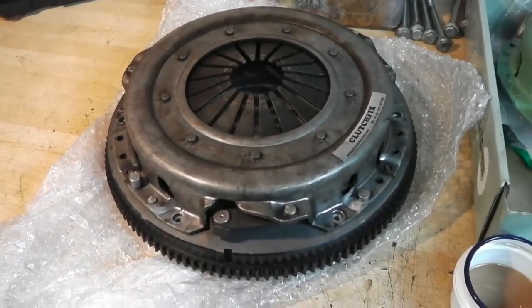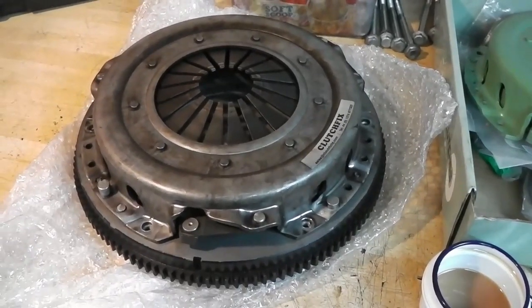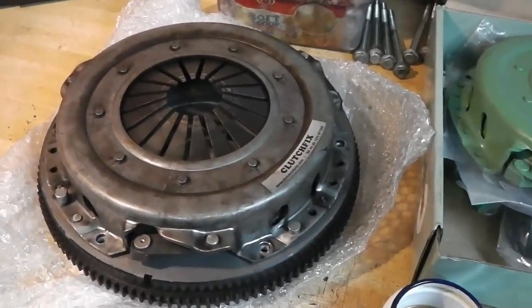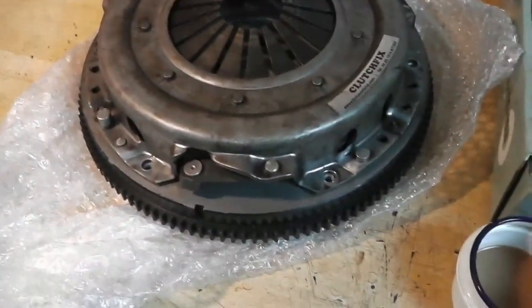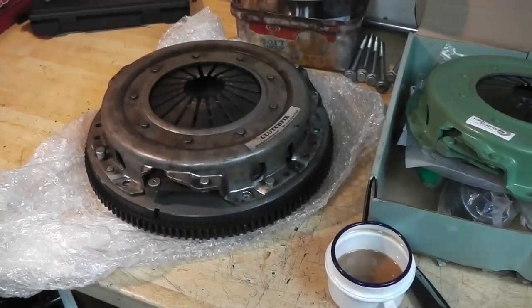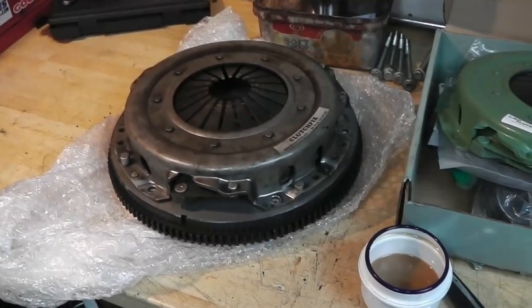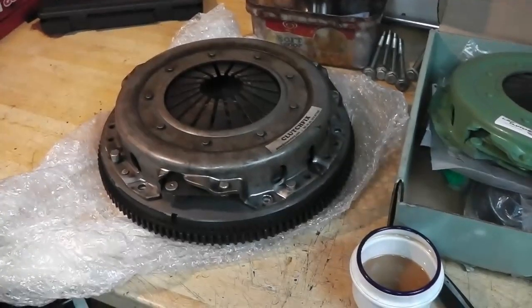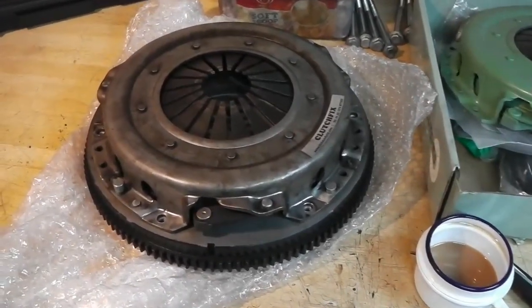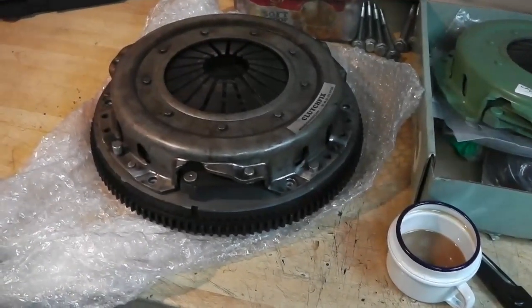I've compared the flywheel from the 2.5 to the 2.25 - the difference is the ring gear. Everything else about the flywheel is the same apart from the bolts that hold it on, where you use special washers and a retaining ring. The Series starter is the old early Lucas type that throws the bendix in, whereas the 2.5 uses pre-engaged types with a solenoid. Knowing the cost of a new Series 3 flywheel which would fit the 2.5 crank, I think the route to take is to use this flywheel and a pre-engaged 2.5-type or Defender-type starter - which is probably a good step up really. It just needs a little bit of wiring: literally just adding a signal wire to the solenoid. The reason I painted this flywheel was because it was quite rusty after being blasted - it'll be faced off before I use it, but it got painted around the ring gear on the back just to stop it rusting while it sat around.